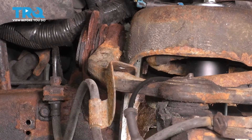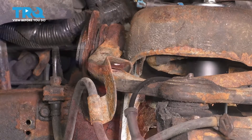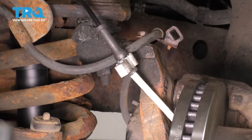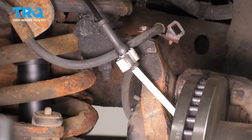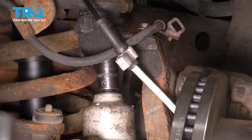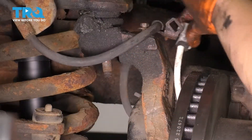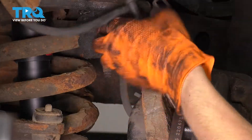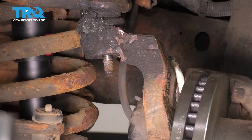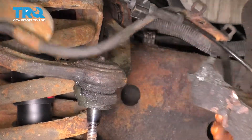I'm going to leave this bolt in since I know it moves and slides in and out. I'll leave it in for now so I can support the control arm, and then we can take it off the ball joint. I put my pole jack underneath the lower control arm to support the weight of it. That way when I take off this nut and it separates, nothing goes flying and everyone is safe. With an 18 millimeter socket let's remove this ball joint nut. Move your wires and hoses out of the way so you can hammer on here and break the ball joint free from the knuckle. Knuckle falls down — that's fine.